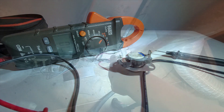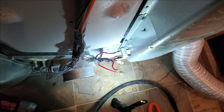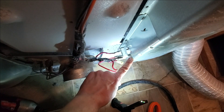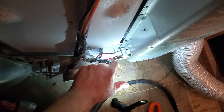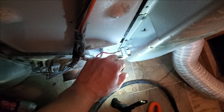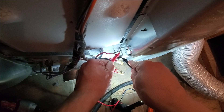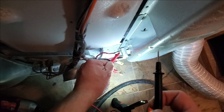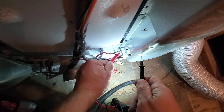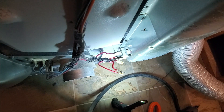This thermostat is good. These are where you hook up the element. I can already tell by listening to it — it sounds like it's touching. We don't want this to be in contact. This here is just a giant loop of a heating element, so both these terminals should touch each other. We do not want to hear that beeping noise if I touch this — and we do hear it. So we're going to pull this element off.